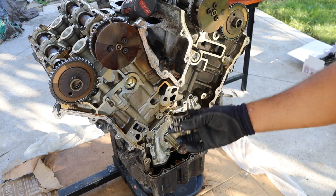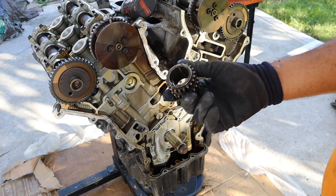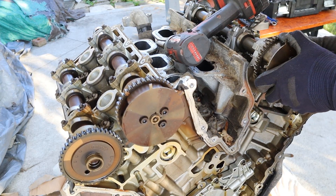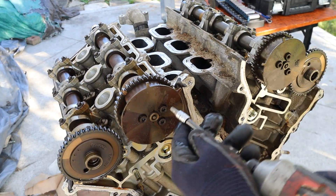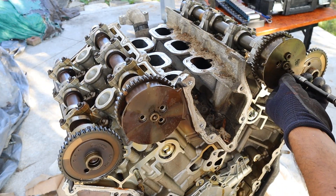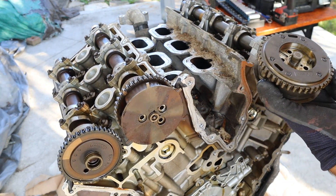And then remove the crankshaft gear — at least this is keyed. The harmonic balancer itself is actually not keyed, in typical Ford fashion. Usually the springs are pretty tight in variable valve timing gears, but this one I can actually move by hand — that's pretty interesting. Let's remove these bolts and see what we have inside: a variable valve timing gear. This one's a little bit interesting.